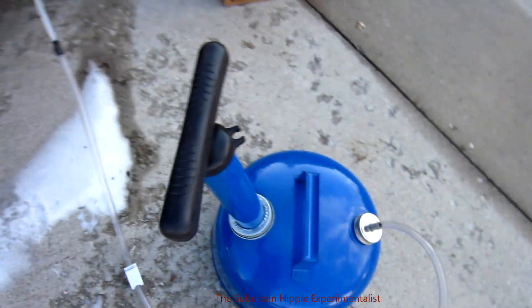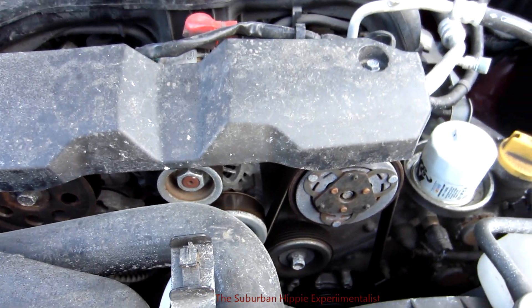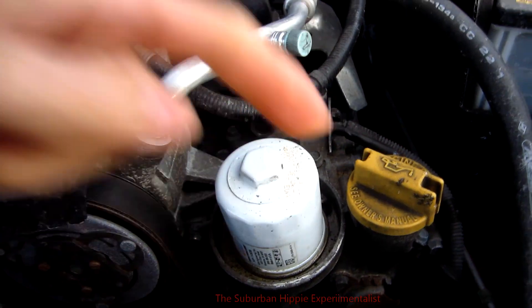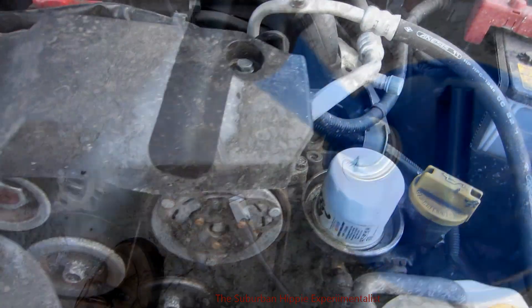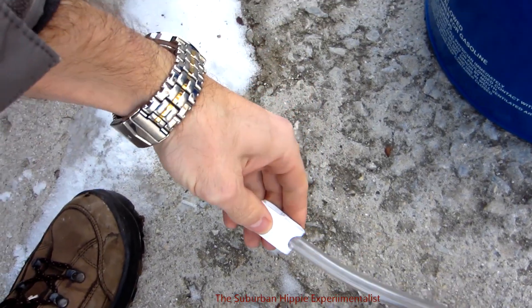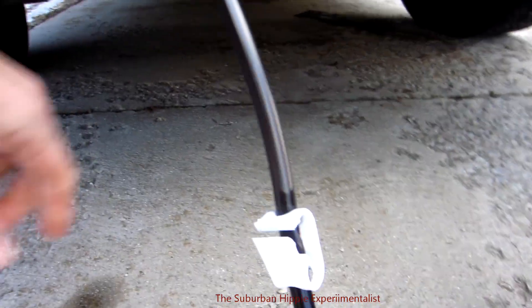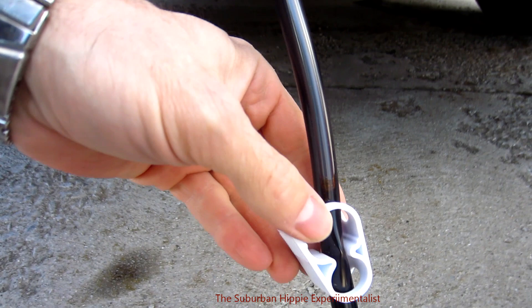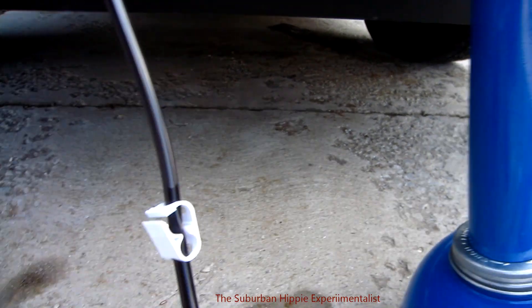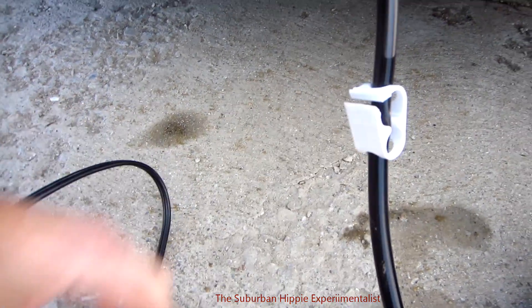You pump this up and put it in the dipstick from the top. Jill's car is the perfect car to try this on because if it works I don't have to climb under the car at all — the filters are on top too. The first thing they tell you is to close off the valve and pump 30 times. I ran into an issue: the stop valve wouldn't close in the cold — it's 49 degrees and this has been in my shed. I had to heat the tubing with a hairdryer to make it soft and pliable.